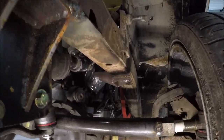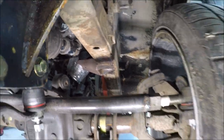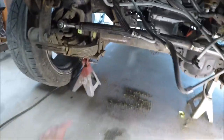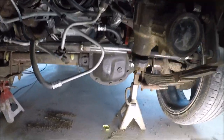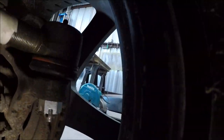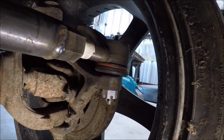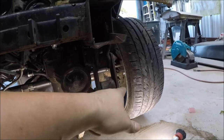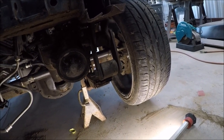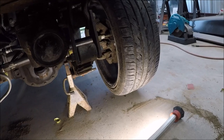Here we are at the bottom — right over there is where our motor mounts are at. And this is what I was talking about — clearance issues. Right over here, the outer tie rod end was actually rubbing up against those stock wheels. So we had these wheels out of a Mustang and we just put those on there — it's the same bolt pattern. Apparently Mustangs and Jeeps have the same bolt pattern, so that's a fun fact right there.